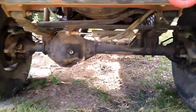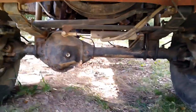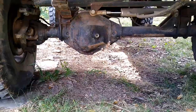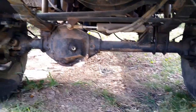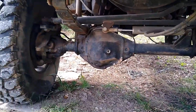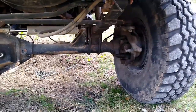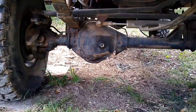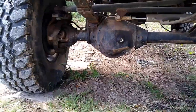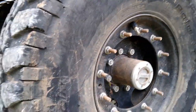Up front on the Top Hand we've got a Dana 60 — this one is '92–'93 vintage — outfitted with the same 5.13 gears and a lunchbox locker, just like you saw Duddy install on his Death Charger. They work real well. This one did sustain some damage a few years ago and required a pretty much complete rebuild — exploded three out of four axle shafts. All that stuff got replaced with chrome-moly, 35-spline inner and outers, and bombproof U-joints.